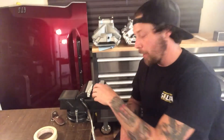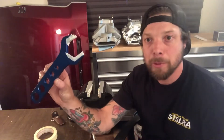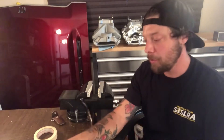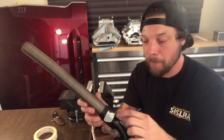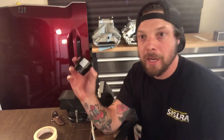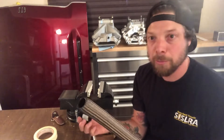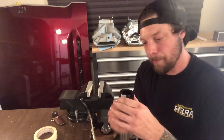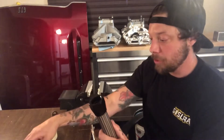In the side shop I got the vise set up with soft jaws — you definitely want those for handling AN fittings. I even put some extra masking tape on them as well. I'm using a proper dash-20 AN wrench, and I always put some extra tape on there because these things are easy to mar. I got the back assembly on already, then took it back to the car, marked where top was, and threaded the other nut onto the other fitting to find where it would stop — that will be top of the other side. Then I line the two tape marks up so the fittings land correctly: the 90 where I want it and the 45 where the other side needs to be. Slide them on, start threading by hand, then throw it in the vise and thread the assembly further with the wrench, making sure it doesn't push the back end out.